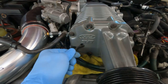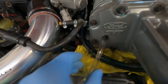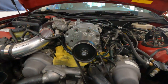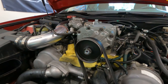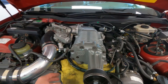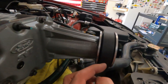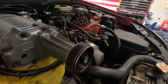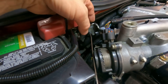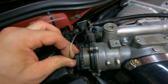Use a MightyVac with a smaller tube on it into the snout — bend way down inside of there, pump it to get some vacuum going. Smaller pulley is installed. It's a dry fit right now which means there's no oil on the snout and these are not torqued down — just tight. The highest part now is the belt itself, and you can see it's in the center of the eight ribs because it's a six-rib belt. Secure your cable in this new bracket and then tighten it with the 14mm wrench.